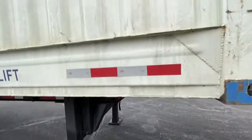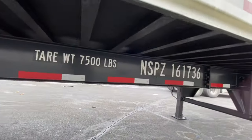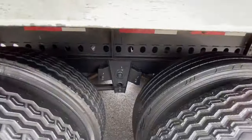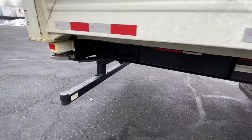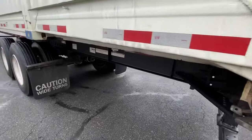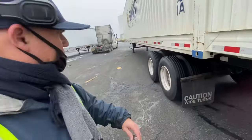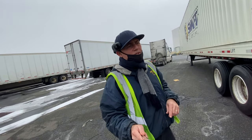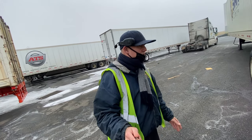Sometimes they'll break on the back, so look it over, look the trailer over. Check your tires — touch your tires, kick them. I don't really have tools to check the pressure, but as long as they look good, you should be fine. Look over your mud flaps. You got to tie these down — if you don't tie these down, they can tilt over and cause a lot of damage, casualties, death. I've seen these on video on the ground.